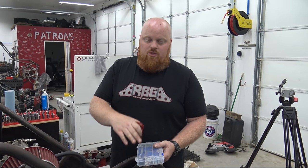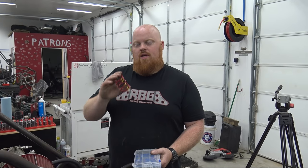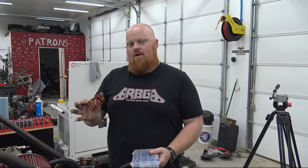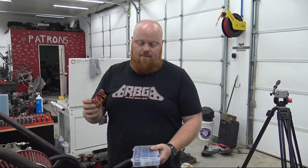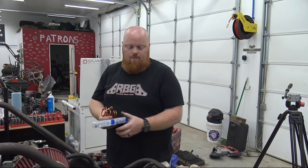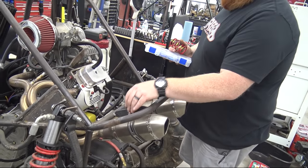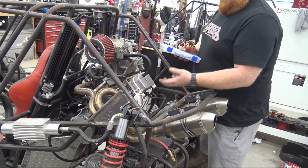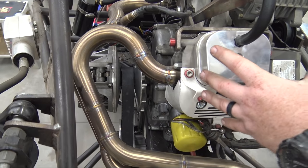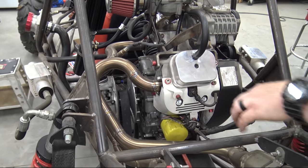He even explained how we need to tune this. He said we need to put the heaviest weight at the heel of it, the very closest to the pivot point first, and see if our engine bogs under that, and then start adjusting from there. So we need to get our takeoff, then you adjust for top end, and then go back to mid-range, is my understanding. So what we have to do to get this CVT pulley off, we have to remove both mufflers. We can leave our header, I believe. Remove both mufflers, just two bolts and four springs. Then we gotta remove our belt on our CVT, and then we can unbolt the engine, which is four 9/16 bolts, and we can slide it over to have enough room to pull that pulley off.